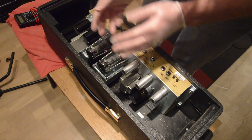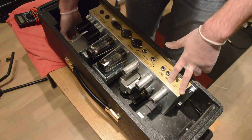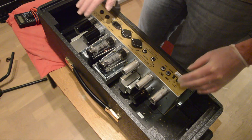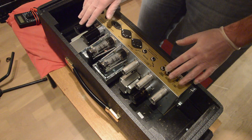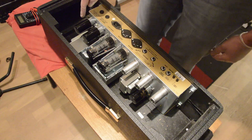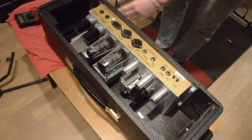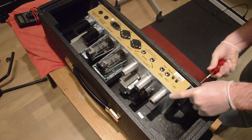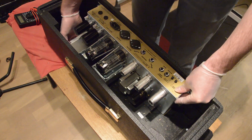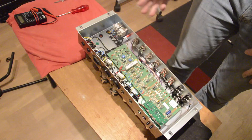Now that I have my gloves on, I like to remove the chassis from the cabinet. When removing it, I hold it at the transformer and at the chassis, because the transformer has a lot of weight and you don't want to be touching those two capacitors — they hold really high voltages and will really hurt you. Stay very clear of them. First we need to remove these four screws here.